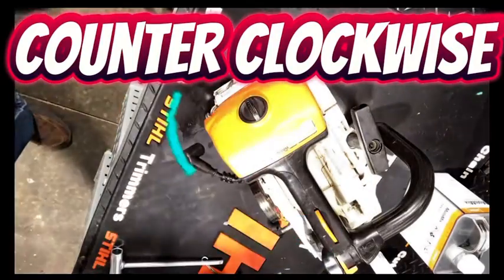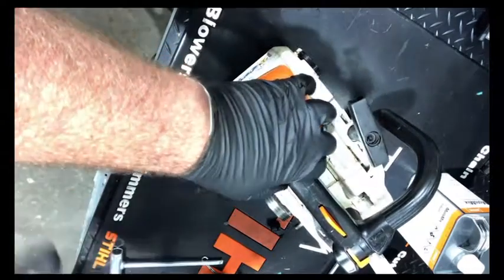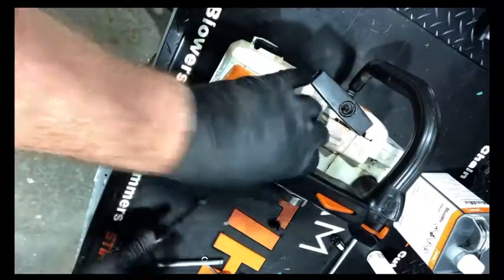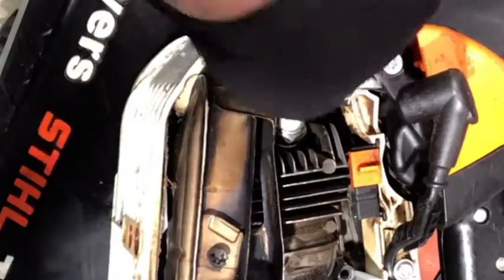So you will also need to have that piston stop in when you're trying to tighten them down. If you guys don't have a lot of experience tightening the clutches, make sure that you do them by hand instead of using impact like I do. That way you don't do any damage to the piston. After your clutch is on, go ahead and pull the piston stop out, reinstall the spark plug, and now the repair is done.